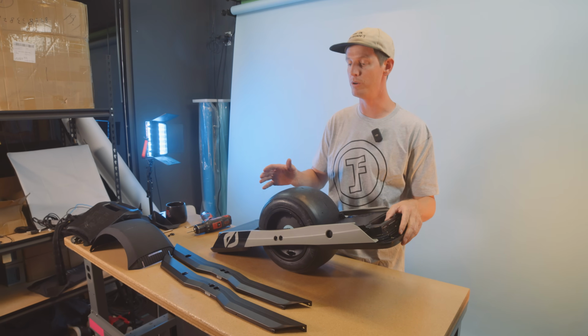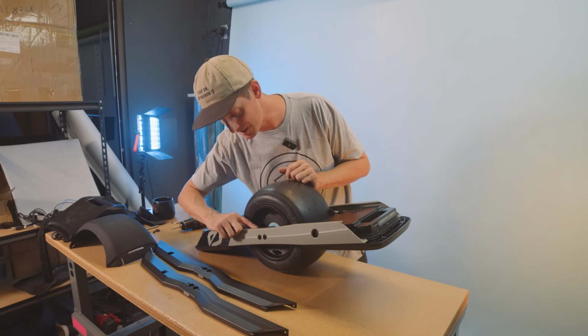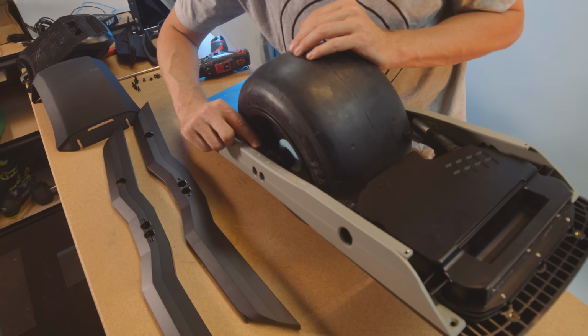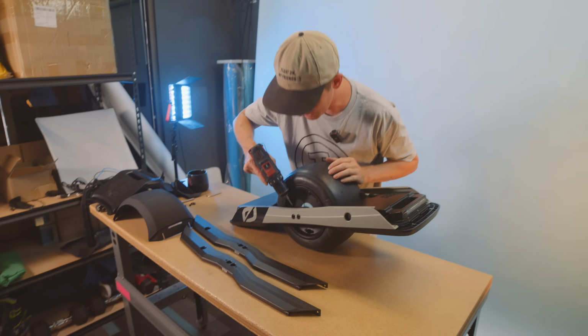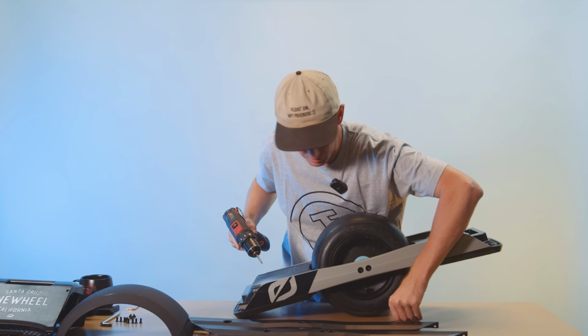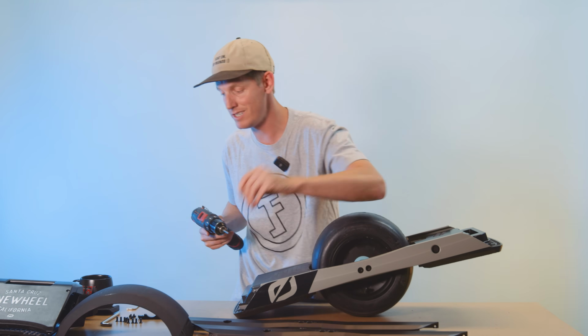So once you're done with those, the next thing while we're on the back side of the board anyway, we can pull off these little covers for the axle blocks. So it's 2 of the TP25 screws right there. You should just be able to yank those out super easy. And those will fall right off. Don't lose those screws because those aren't fun to replace.